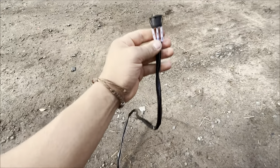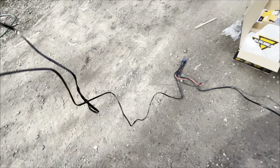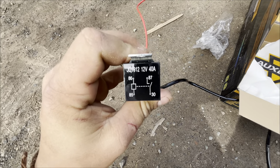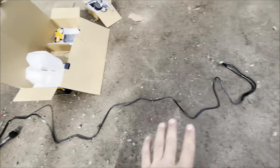This is a cool little switch but it's not the switch I'll be using — I've got to shoot off later and get a rocker switch to suit the cab. Long story short, this is the cable that goes through the firewall. You then have a fuse so your whole circuit is fused. I checked earlier — it's a 25 amp fuse, which is more than enough for these lights. It runs through a 40 amp relay, so the relay handles most of the current when switching. It hooks up at the battery, you get a switch side, and then your light side. I'll likely need to extend that switch cable because of all the bends going through the interior.